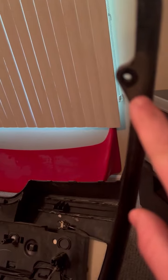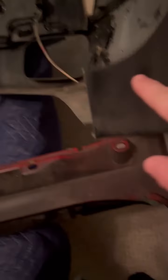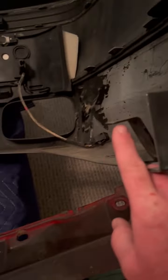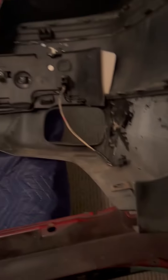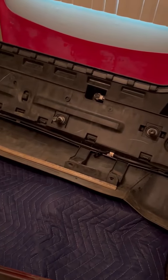From the top of the rear wheel — this is the rear fender — you've got one Torx screw here, and then underneath you're going to come underneath the car and you've got another one right here. So super simple: four bolts across the back, and the rear bumper pops off.